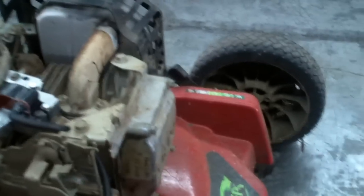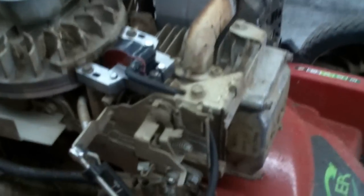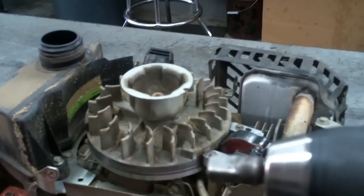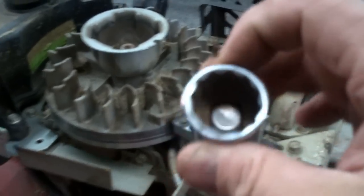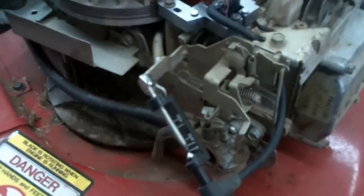10 thousandths — like I said, a business card works just fine. In my last video, which I'll link in the description, several people asked how I was turning that motor over so fast. A lot of you were right — it was just a drill with a 3/8 socket adapter, and then from that a 3/8 to 1/2 inch adapter so I could go up to a 15/16. They may make an adapter to go from the drill straight to a 1/2 inch drive. Let's spin it over and see if we have spark.